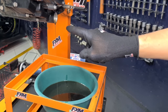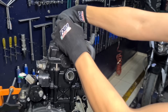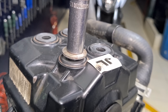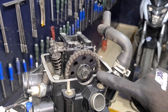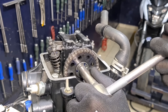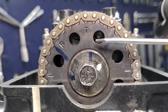Once our oil is drained, we're going to start with the disassembly of our cylinder head, always releasing the bolts in a cross pattern. Now we're going to put our engine in timing — for that we align the timing sprocket marks here on the cylinder head, and we verify the flywheel guide in our flywheel cover viewer. As we can see, the distance between our sprocket line is equal on both sides, which means our camshaft is in time.